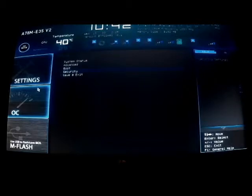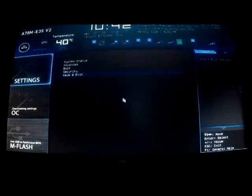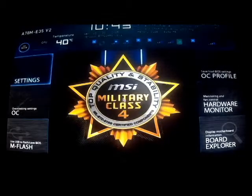And then, again, hit settings, save and exit, save it, get out. It'll reboot, it'll boot directly to the hard drive, and your backup of Windows running. I'm going to just hit escape because I don't have really any changes to keep. So it'll escape one more time, quit, and that's that.